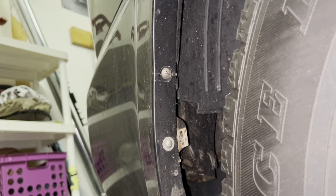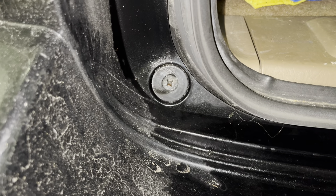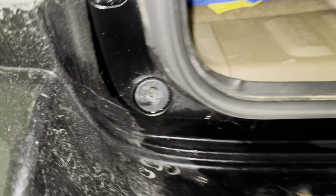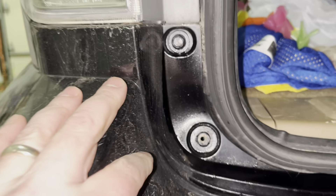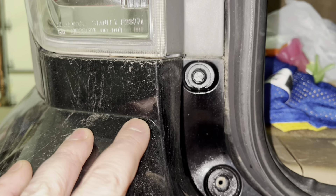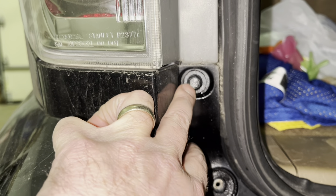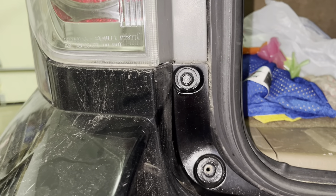Keep that in mind when putting it all back. With the four screws removed from each side in the wheel well, I'll now go after the screws — one on each side — inside the tailgate. Once those screws are removed, also on each side, there's going to be a bolt above where you removed the screw. That's a 10 millimeter, one on each side. Remove those.